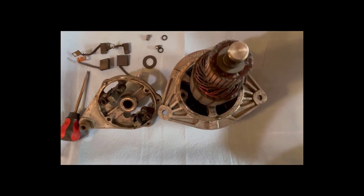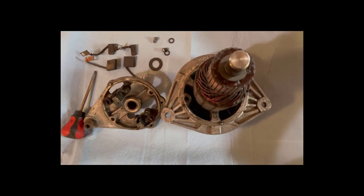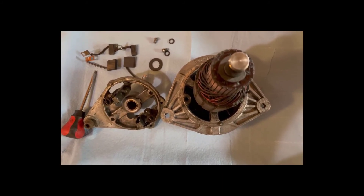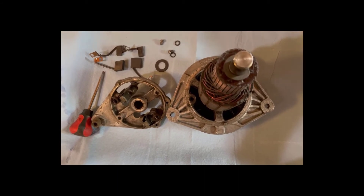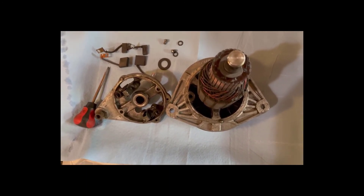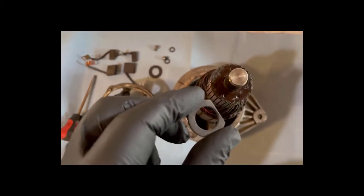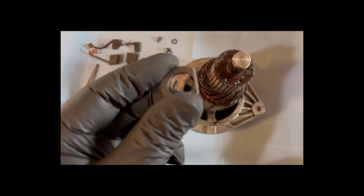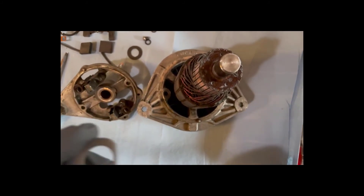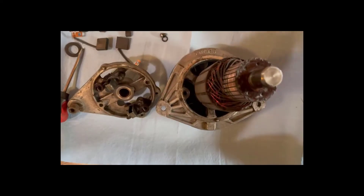We've cleaned up the armature and have new brushes to replace the worn brushes for the Morris Minor. But before we clean off all the paint from the casing and everything, we want to make sure this thing works. There's something important to point out on all these little Lucas C40 style dynamos or generators, which is that they have a fiber washer at this end. This one is broken and it's almost done. Sometimes you'll find them without the fiber washer, or you might not notice it's there and it falls off when you're servicing it. So you want to have that in place, and we'll replace that one with a new one.